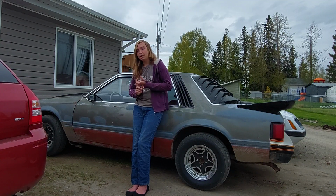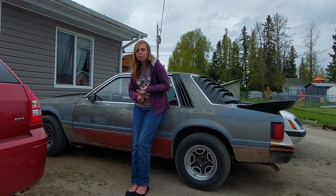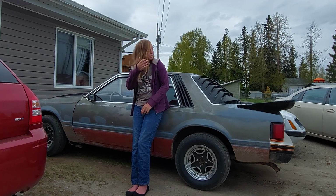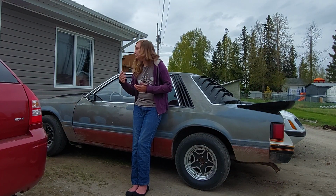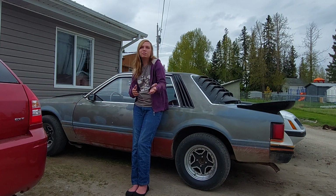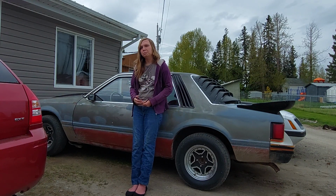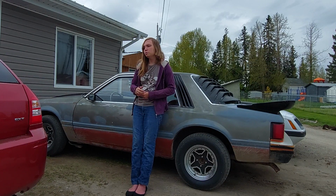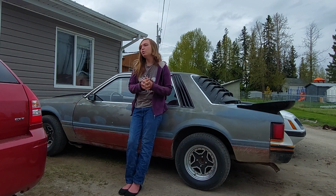because it's sat for 20 years, we're gonna have to drop the fuel tank out of it, clean out the fuel lines, probably go through the brakes because I don't believe it has any. We don't have keys for it, so we're gonna have to get keys made, which starts at about $231, but that's okay, not the end of the world there. And then basically see if the thing will run too, and show you guys the process of actually testing a vehicle's health for it to be properly run and as well showing you guys how to do an oil change and stuff like that too. It's gonna be a really fun ride, and I hope you guys do enjoy it,